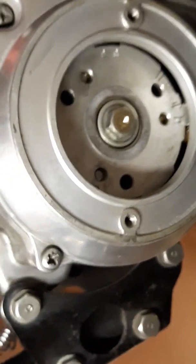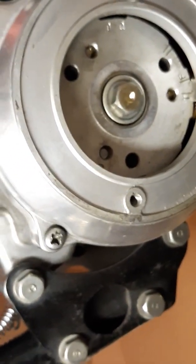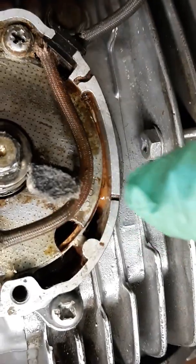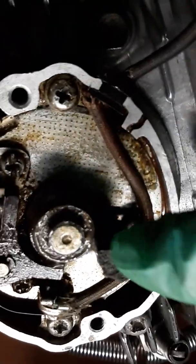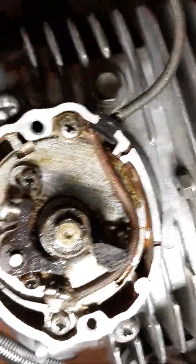I hope this was useful for you guys with the old bikes. On this here, this felt washer — I had to make this myself; I showed you in one of my previous videos. It's still holding up, but I notice I've got to oil it up a lot — every hundred miles oil it up. I've got this Permatex tune-up dielectric grease. I'm using this as well as regular oil. I soak this up with oil and put the dielectric grease on the cam because I don't want it burning out from too much friction.